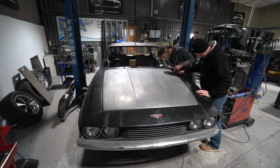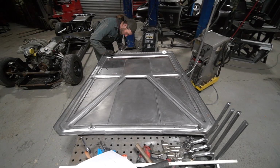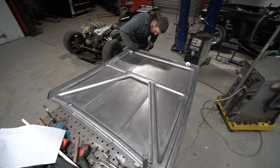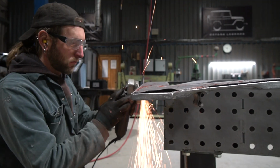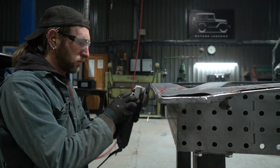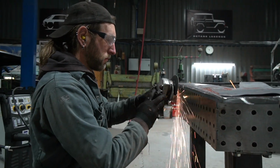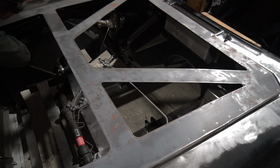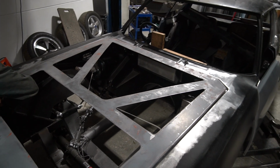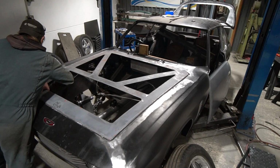There is a similar problem to the one we have with the doors, in that the way the outer skin has been fixed to the inner skin at production has caused defects in the panel that we can't remove due to the frame blocking access. So Matt's de-skinned the bonnet and got it all ready to reskin, so we're just waiting for a new skin for that now. Same process happening with the doors. We mentioned that last week.